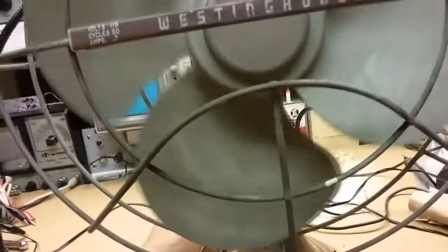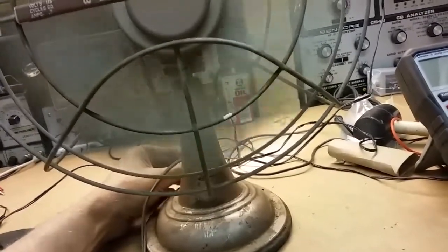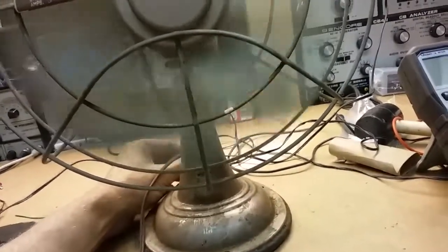If I click the switch one more time, it's drawing nothing — that takes it to zero, which means off, which is probably supposed to be medium. One more click and it's still off. So there are some issues with the speed on the switch. The way the switch is working: click it once, on — I don't know what speed that is because some speeds are not working. We get on, off, off, and back on. It should probably be on, low or high, and then off. So one of the speeds is not working, or the wrong switch is in the fan — it's a three-position switch and it's only supposed to be a two-position switch. We're going to figure that out right now.